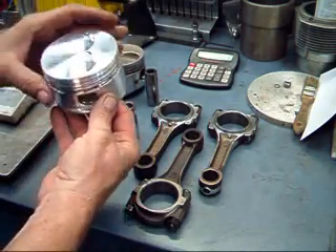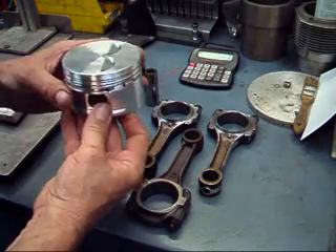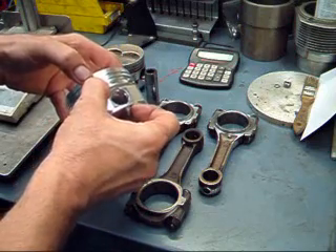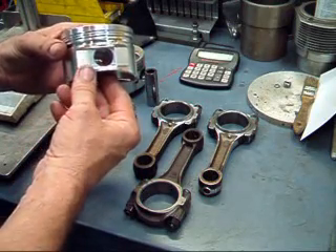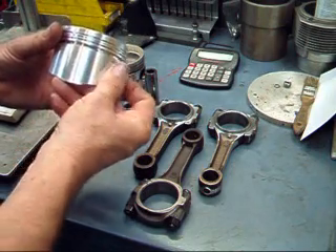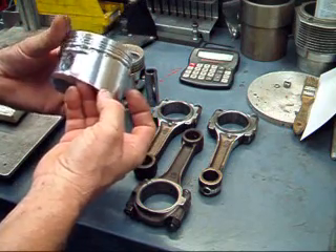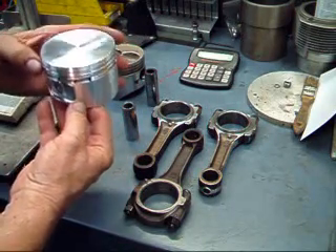The pistons that I've designed and had made by JE are a little bit different. You can see that the valve reliefs are much shallower than they are on stock. I've also had a contact reduction done to the top of the piston, and I've also had an accumulator groove cut in between the top and the second ring. I also have grooves cut for spiral locks, which is a little better system than the spring wires that they have normally. We have a fairly consistent surface finish on the piston — it has a little bit of texture to it, so it'll hold a little bit of oil. This piston may see a turbo at some point in time, and so I want to make sure that I have everything done right the first time through.